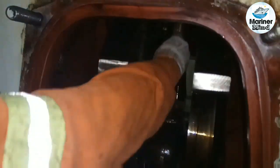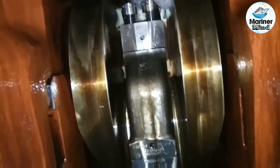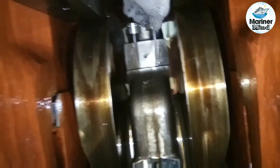The tools are being shifted from one side to the other. Put a mark on the nut and connecting rod so that when tightening later, the nut can be returned to the same position as before. Slowly remove both nuts on either side and mark their positions.